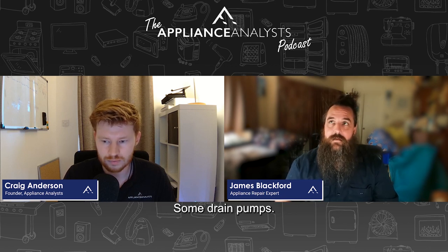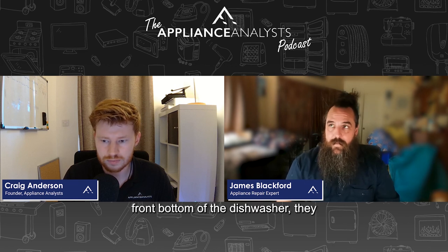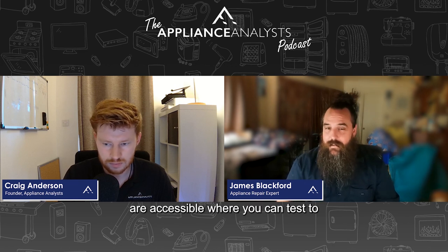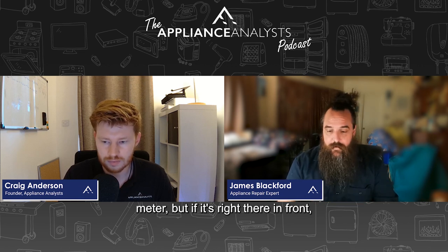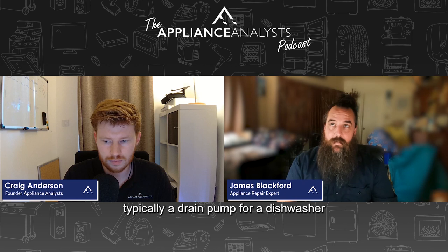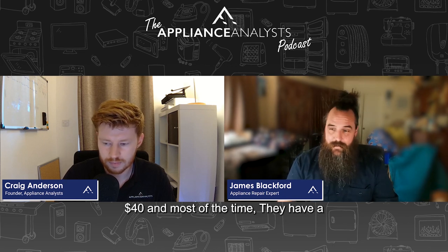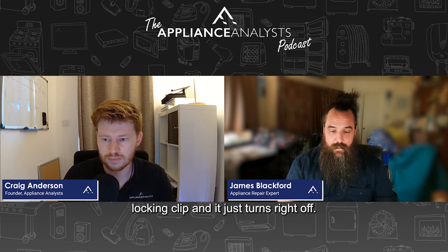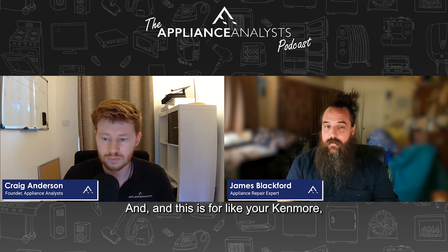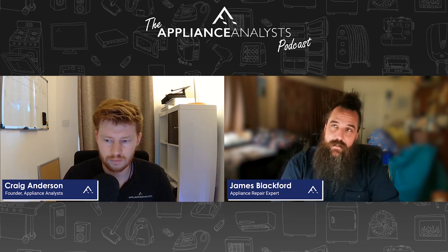Some drain pumps, if you remove the access panel on the front bottom of the dishwasher, they are accessible where you can test to see if it's getting electricity with a meter. But if it's right there in front, typically a drain pump for a dishwasher is anywhere from, you know, $20 to $40. And most of the time, they have a locking clip and it just turns right off. And this is for like your Kenmore, Whirlpool, Maytag, that kind of variety. Mm-hmm. That's pretty much it.